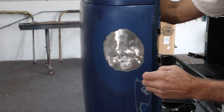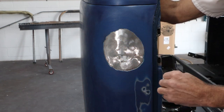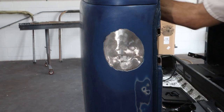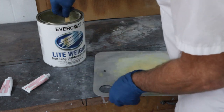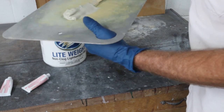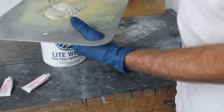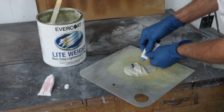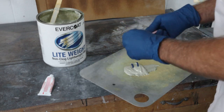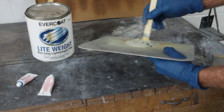We're ready to fill this, and if there's anything left on the mixing board we'll jump to the firewall where we filled all those holes and flatten that out a little bit - fill that little rib right there and get that sweetened up. Let's get some body filler mixed up. Stirred up the can real good - it had been sitting a while since we did the bed. I'm not going to need a lot, but I plan on going over to the firewall so I'm going to make a little bit more than I probably should. It's 60 degrees in the shop, so I'm going to add a little more hardener than I would in the summertime.